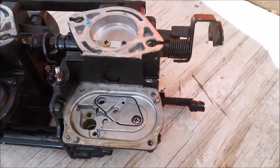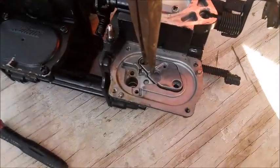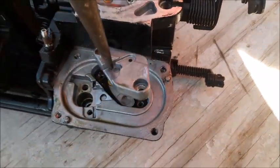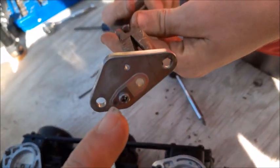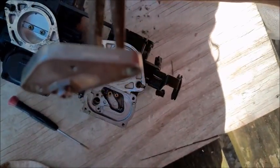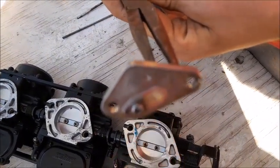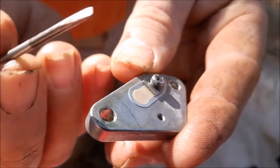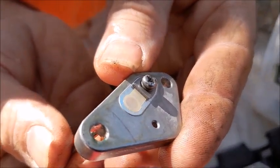Next, we'll take out these two screws that have this little cover plate here. You can use your needle nose pliers to lift it out — it's a little snug at first. When you look on the back side of it, there's actually a little flapper valve right here — it's like a clear plastic flapper valve. If it's actually sticking out where it's warped or something, then you need to replace it. If you're not going to replace it, also make sure it's not stuck from old gas sitting on it. With a small screwdriver you can see how the flapper goes up and down.